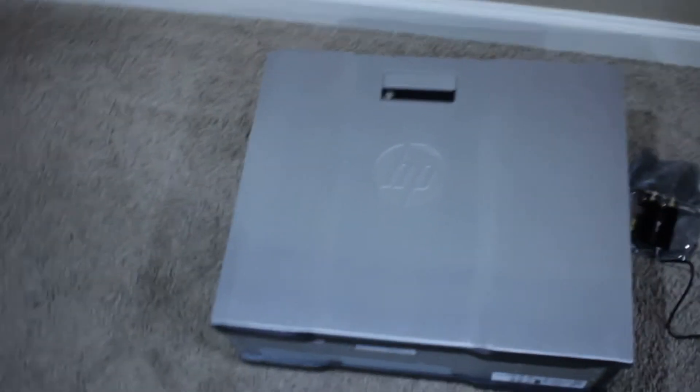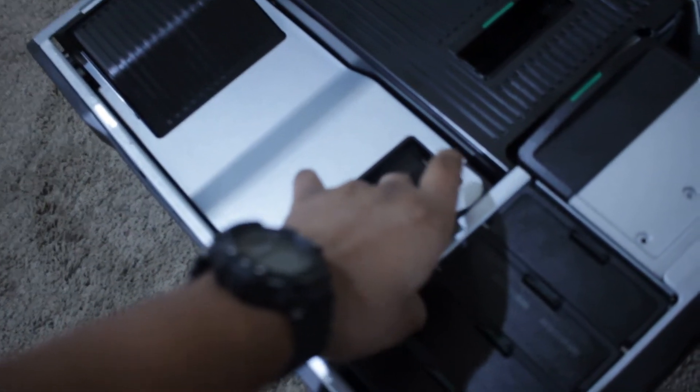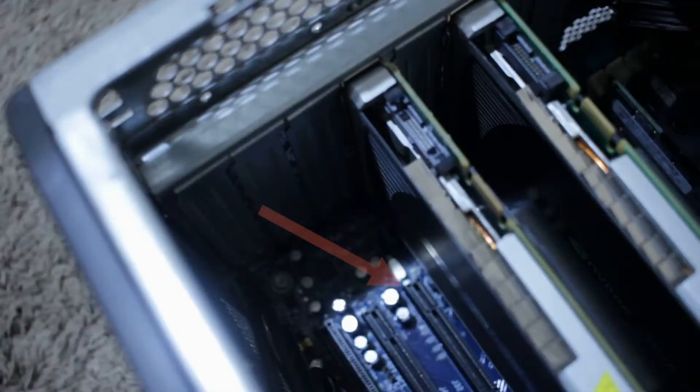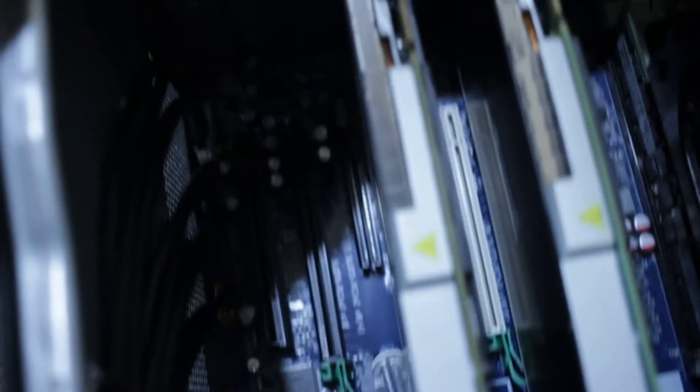Here's the PC and the Wi-Fi card. To remove the panel, there's just a button to slide it right off. This computer has tool-free bays — you squeeze the tab and lift it straight up. Those two cards are the graphics cards. The Wi-Fi card is going to go in the first short PCIe slot, because that slot fits this card. The other longer slots may not fit.